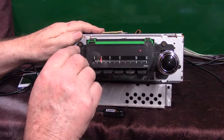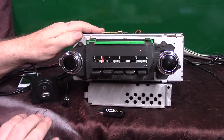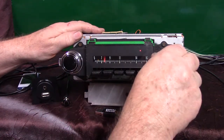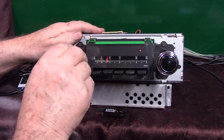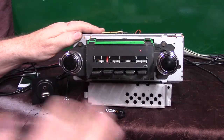Say you like a station — all you do is take the tuner knob and turn it one time. She'll say 'Station hold' and lock on that station. If you don't know where it's at on the dial, just start turning and it'll show up. Pull out a preset and you've got it. That's how you scan stations — it works on both AM and FM.